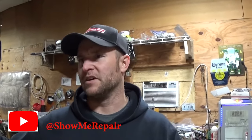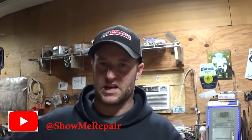This thing runs cold — even when it's probably in the 40s right now — and this truck has been running. It's a customer of mine. I actually just swapped engines from a wreck truck of his into his new truck. I have a ton of history on this engine, so I was really surprised when this happened. What I like to do on these is air test them to figure out where the air leak is coming from, because it's usually from an oil rail, usually a D-plug or a standpipe.